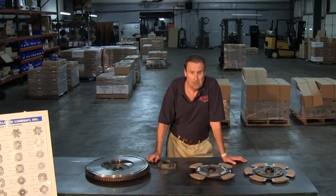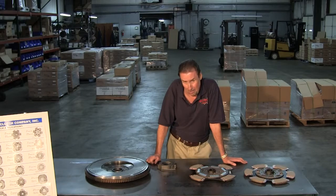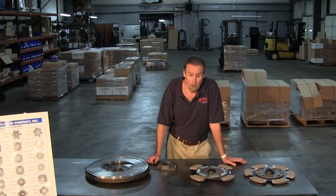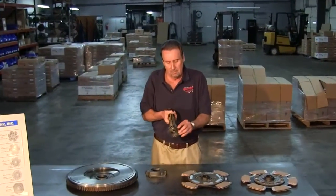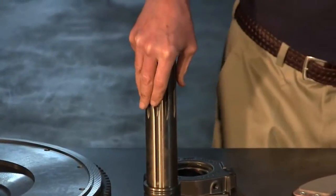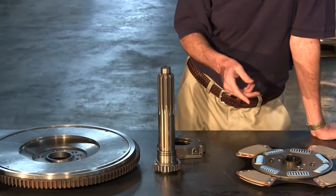Now, the next thing we want to talk about is we're saying we're using 10 springs in places of 7s. Well, it was working pretty good for a while, but now the situation has arose with the FRO transmission series. Well, the FRO, or let me show you, has got a lot smaller teeth on it. Also, most of them are used in what we call a low emission engine, which means they idle at a lower RPM, which means they idle rougher than normal.